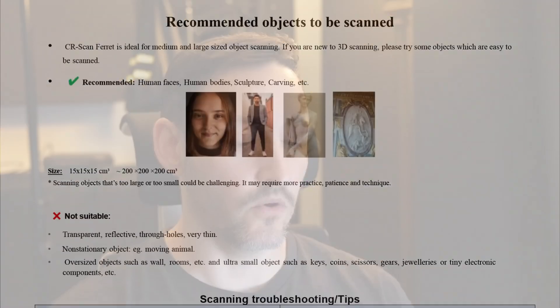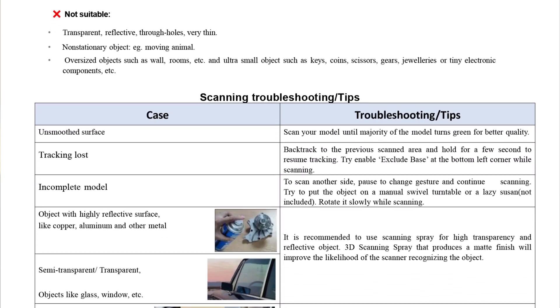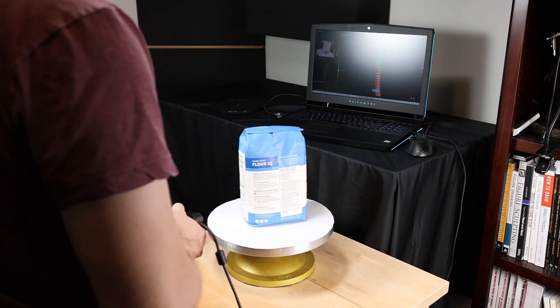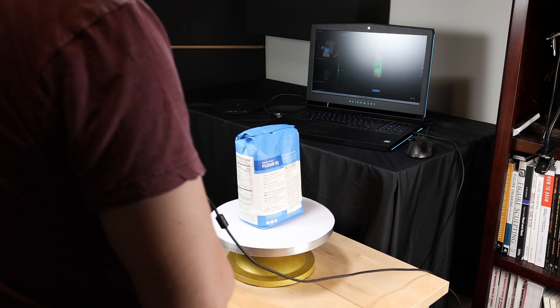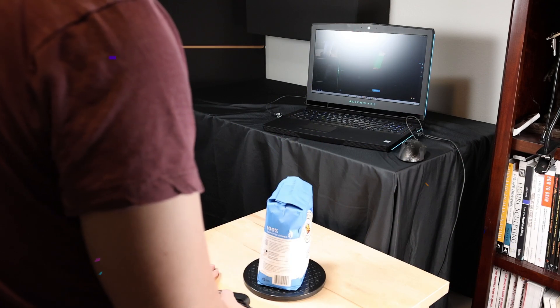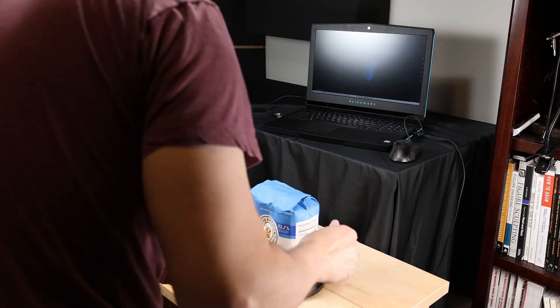I will say it's not a miracle scanning machine. All the same pitfalls that come with photogrammetry apply to the results you'll get from the scan ferret. So anything reflective, anything transparent, has a bunch of hollow parts, has fur or hair — these are really tricky to capture and may not work. It does take a few tries to get a feel for what the scanner needs in order to get a successful scan, and that can be irritating. I've found that moving back a little bit and getting a general overview works a little bit better, and then getting into that perfect zone. Your mileage may vary — it just comes with practice. Don't be irritated right out of the gate. Get in there, feel for what gets you the best results, and try and stick with that.